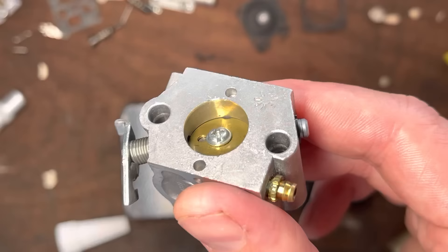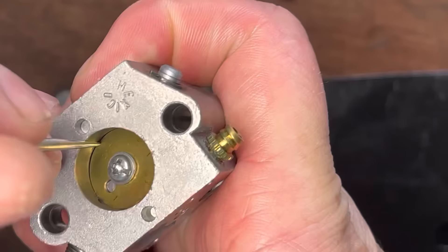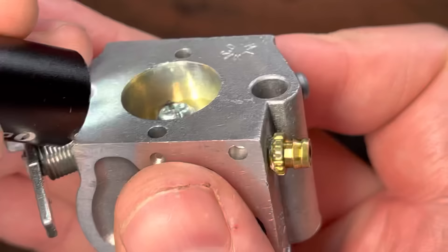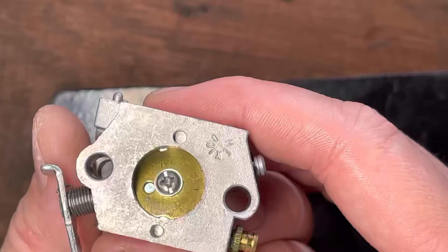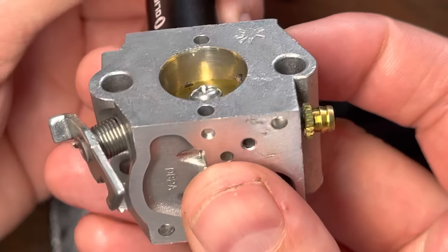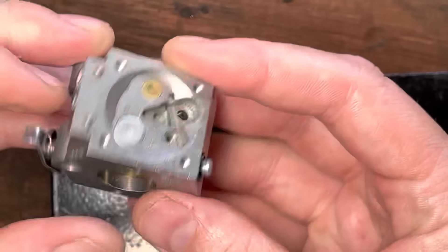The U-shaped cutout of the butterfly should be in line with this drilling. Take a bit of tension off and put it back correctly — there we go. Now have a look: you see that hole? It's right over that cutout. Put a light behind it — there's no light coming out anywhere, which is exactly what we want. Do the final torque down to firm, then double check that the cutout hasn't moved from that drilling. Also check from behind — no light coming out from anywhere apart from the notches. That's how you reset the butterfly correctly in a carb.